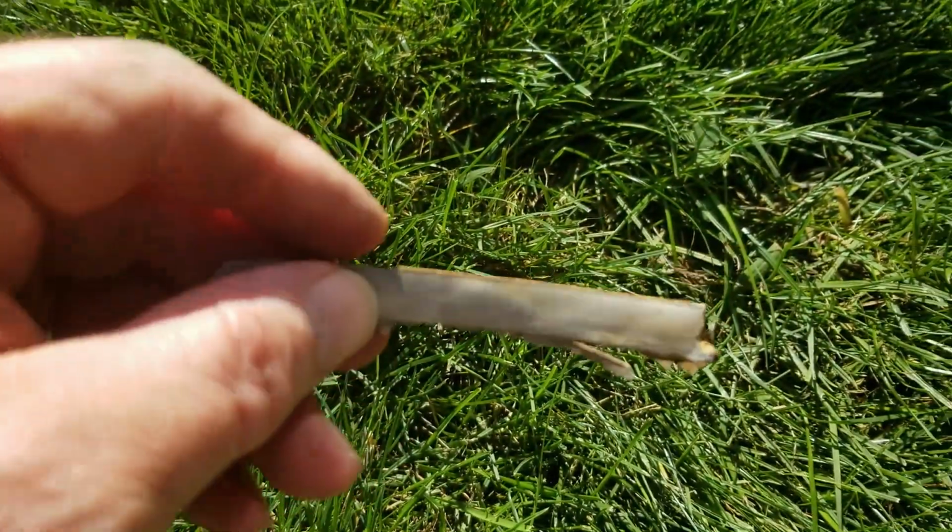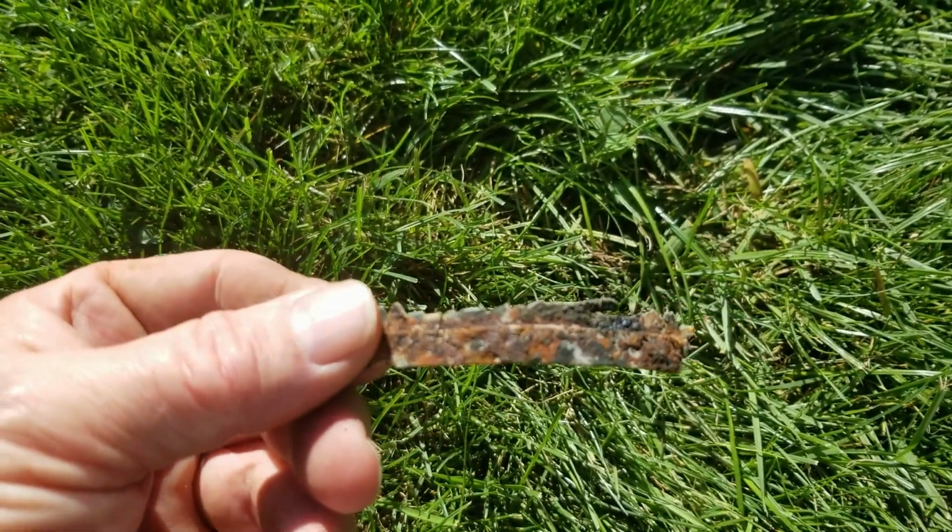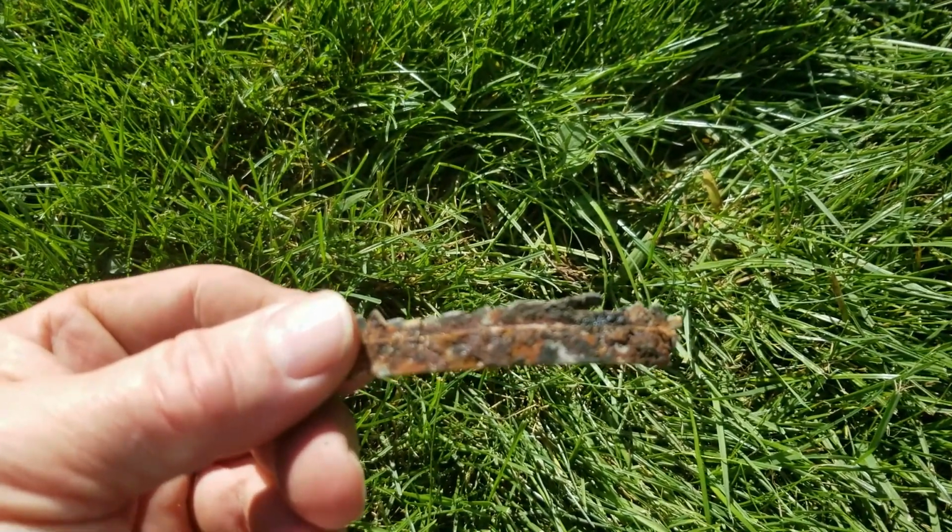Yeah, there was moisture hiding behind that seam sealer, even beyond what we thought we saw. Pulling all that seam sealer out, that entire edge has some surface rust going. And if you look at the seam sealer, this is what we saw on the outside, nice and clean. This is what was on the back side, so it's a good thing we took all that out.